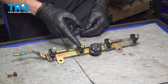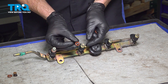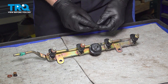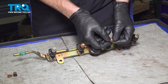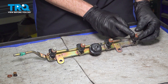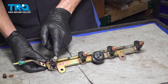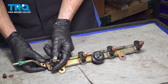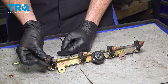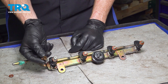Now let's make our way over to the bench where the fuel rail and fuel injectors are. Clean and inspect your O-rings and replace them as necessary. We'll be sliding one over each of the fuel injectors that we are not replacing, and making sure each gasket is secured. The fuel injector we are replacing looks a little different — the very tip that was removed from the intake is still in the intake, so we'll be sliding the new injector into that piece already in the intake.